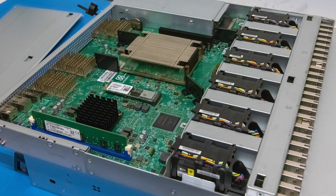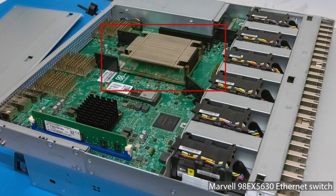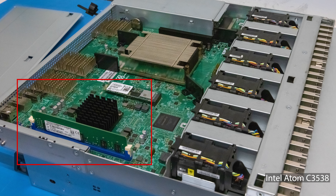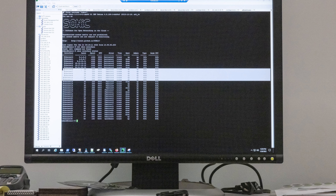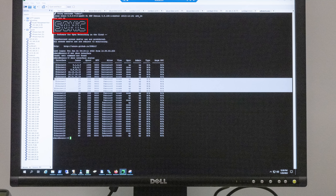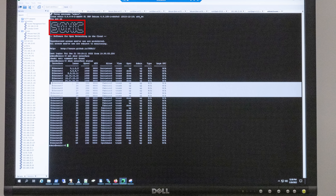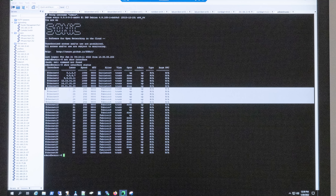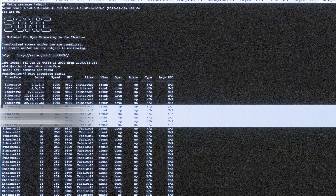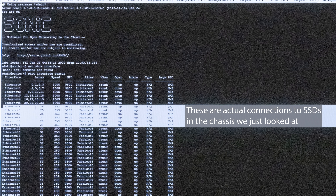Inside the system, this is definitely a switch. Under the big heat sink is actually the switch chip — in this version, it's actually a Marvell switch. You'll also see an M.2 SSD, and that's your storage for the switch. Under the black heat sink, you can see we have an x86 CPU, and then a single channel of memory — that's really running the control plane. When we look inside the switch itself, this whole switch is running SONiC — the big Microsoft Azure SONiC platform, which is the number one thing in software-defined networking right now. You're basically using software-defined networking to control the data flows to and from the NVMe SSDs.